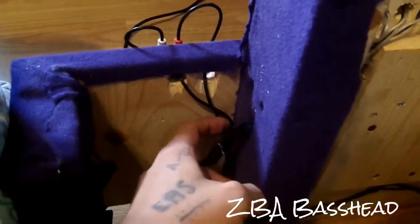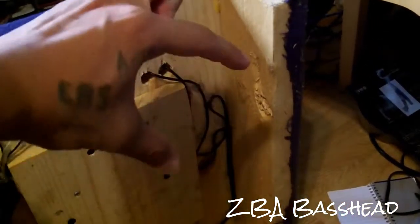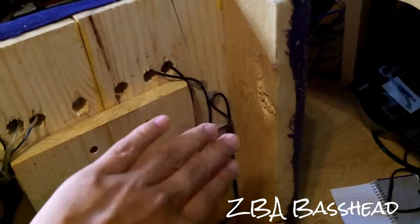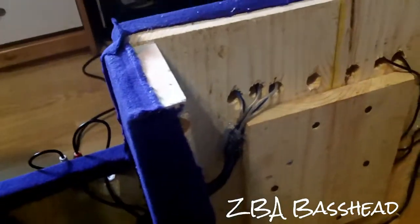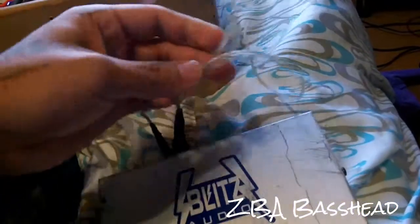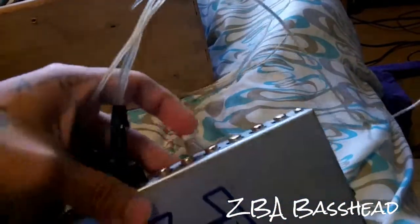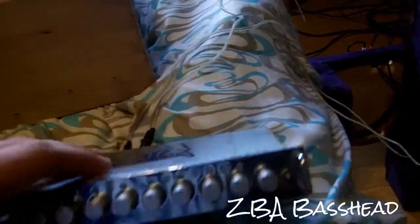Got it all wired and glued. No power wires are touching the RCAs, which run down there — it was kind of too long so I mushed it together and glued it. It goes up to the amp, coming from the bass enhancer. The output goes to the head unit — well, actually it goes to the bass enhancer and the head unit feeds into that. Once installed I'll fix it up so power wires don't touch the RCAs and get a nasty ugly tone through.